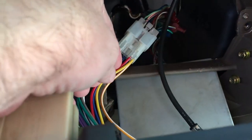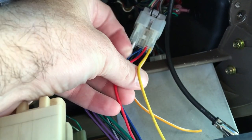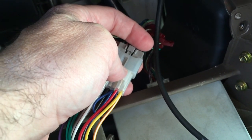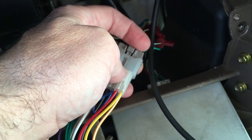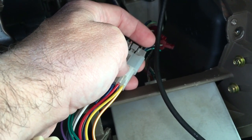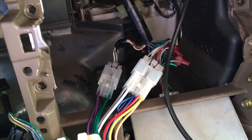When I turned the key in the ignition, I would get power on the red — that's the accessory — but I wasn't getting the battery positive on the yellow. So I hooked my meter in here and measured from here to ground, and I was getting some weird values. I traced that back in a wiring diagram and it said that goes to junction J3.